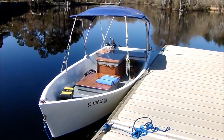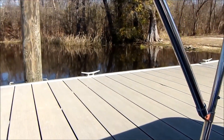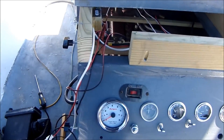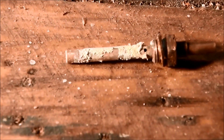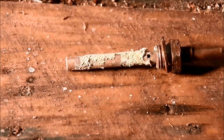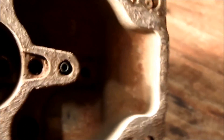It's launch day. Well, I got her in the water. I wish I had some good news. I'm out here loving life — very little wind, got the dock all to myself. Only problem is I can't get the engine to run. Guys, lessons learned: don't spend all winter overhauling a motor and building a boat and then not take a couple hours to rebuild your carburetor. I built this boat, overhauled the engine, been working my hiney off, and didn't take the time to clean the carburetor out.